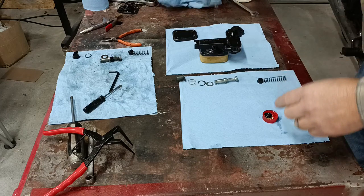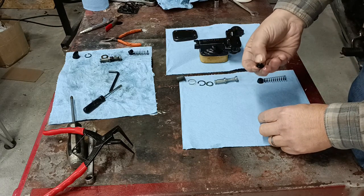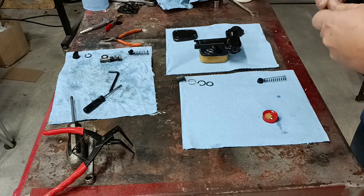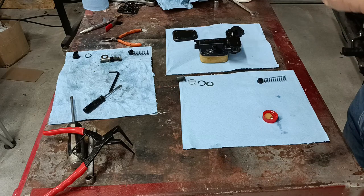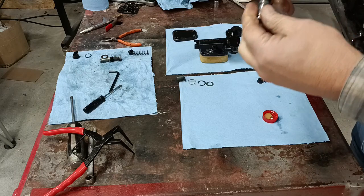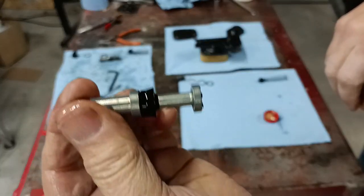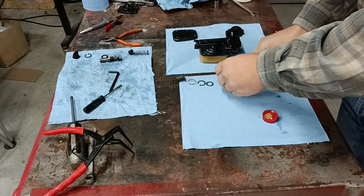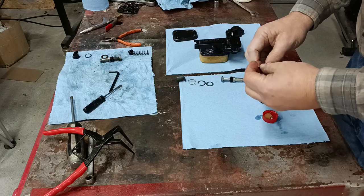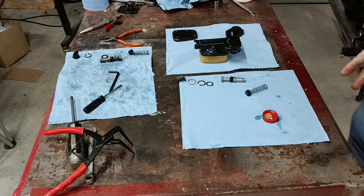Get the dirt off your fingers — you don't want to get any dirt in your new parts. Stretch it over and then slide it down just like that; that's how it should fit. Go ahead and lubricate the spring cup as well. I gave the master cylinder body a quick coat of PJ1 Fast Black and then set it on top of the shop heater for a while to cure.